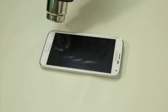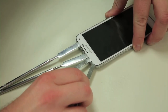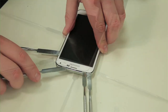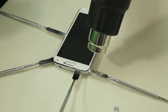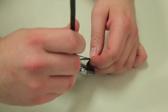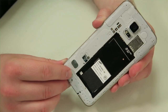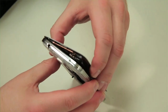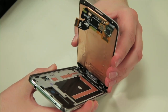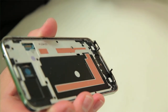Break out your hair dryer, heat gun, or other warming tool and slightly heat the edges of the panel. Then gently pry it loose. Be extremely careful not to overheat the device and warp the plastic, or insert your tools too far and damage the display or other internal hardware. Starting at the top, lift the panel away from the body, but don't go too far — there's a connector here that we must detach. Remember that connector from the back of the phone? It snakes its way through the device and is connected to the home button on the bottom of the panel. Since we already disconnected it, you can gently push and pull it all the way through, and then completely remove the panel and display assembly.